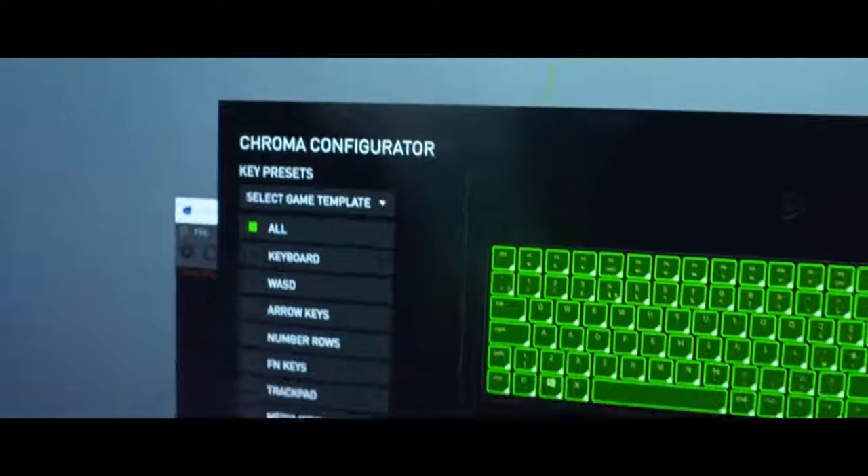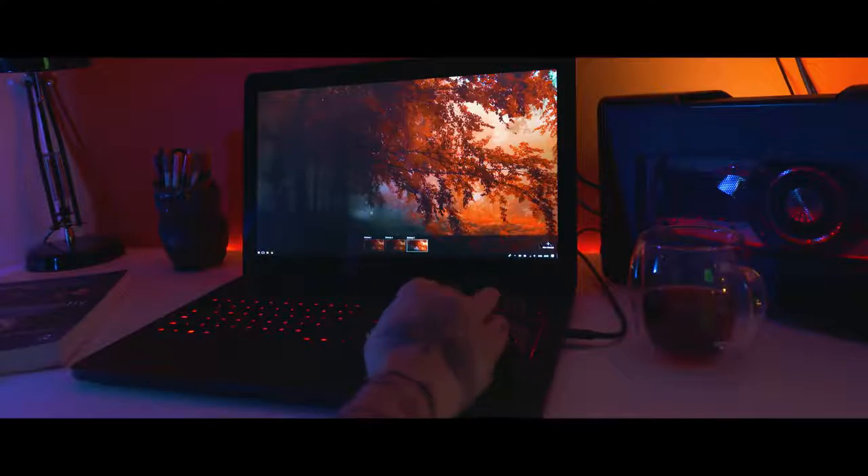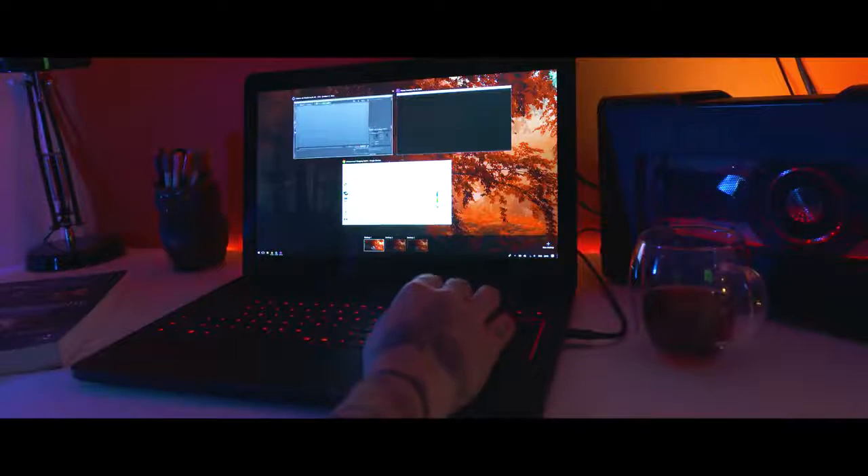Razer's famous keyboard — it looks beautiful. I can customize all those LED lights and it's just fun. It feels nice, it looks nice. The touchpad is in an unusual position, offset to the right, kind of replicating a regular desktop placement of input devices. At first it's unusual, but once you get used to it, it's actually really convenient. All the gestures to switch desktops and apps work great. About a month ago — so after seven months of usage — the keyboard started to glitch. Sometimes the spacebar or other keys just don't react when you press them, and sometimes they overreact and type the symbol twice. And from time to time, the keyboard just shuts down, lights go off for several seconds, and then it comes back.